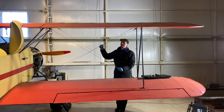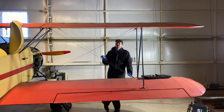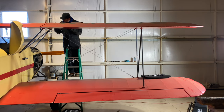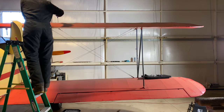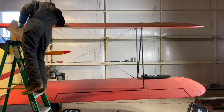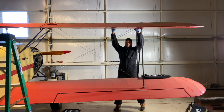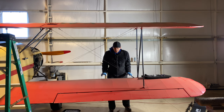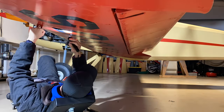We're skipping the flying wires for now — we are going to check the rigging on it. It should be dialed in but we just want to do it a little better and check the numbers to make sure everything is good. The top of the wing is done, bottom of the wing is done, struts are done, pitot-static done — top and lower, bottom and lower. We're going to move all the tools over to the left side and get the left side done.